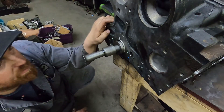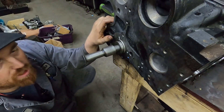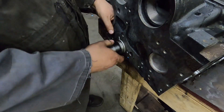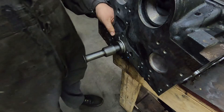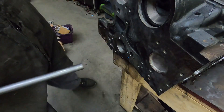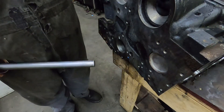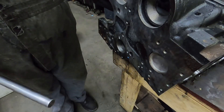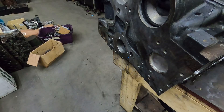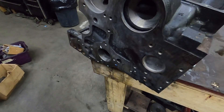If you have one at the back, repeat the same thing. You can do this with other tools, but you have to be very, very careful that you get the bearing straight — because if the bearing cocks sideways even a little bit, the bearing is junk, don't use it, buy a new one. You just have to make sure it's straight, and using this jig — a cam bearing installer, you could call it — that we made keeps it straight. That's the only thing you want to watch for.